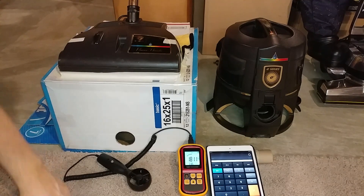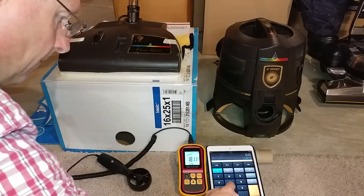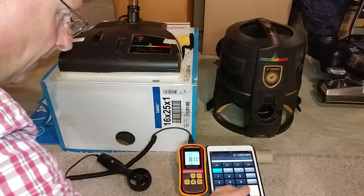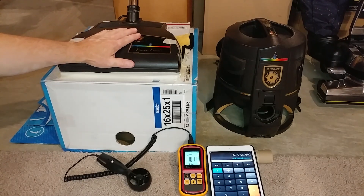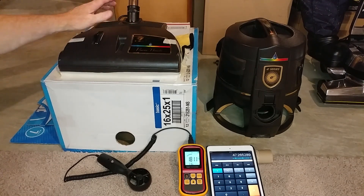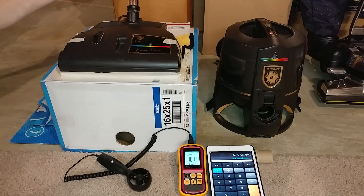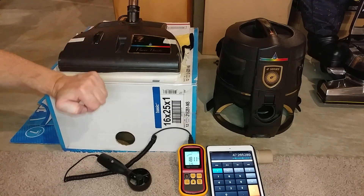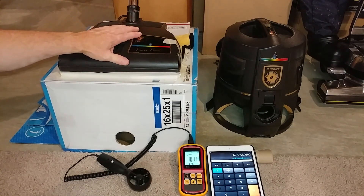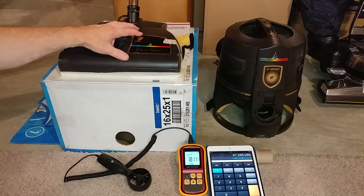Okay, 1811 with the brush roll off. We're looking at 47.3 CFM — that's quite an improvement, but of course the improvement comes from a lot more airflow at this point compared to say a D4. This isn't what you want to hook up to a D4, but you could. Quite an improvement going from a PE nozzle from 1997.